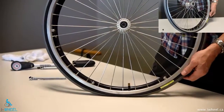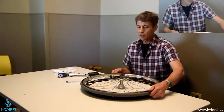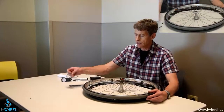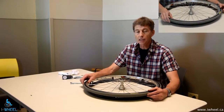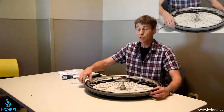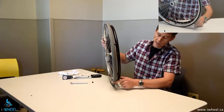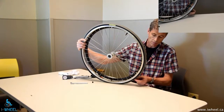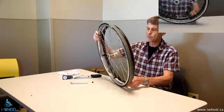However, I'm not going to do that. I'm going to show you how to fix a flat tyre. So let's assume that we've got a puncture — punctures happen typically in two ways. There's either penetration by a sharp object, or if your tyres are too flat and you hit a kerb or an obstacle, you get what's called a snake bite flat, where the tyre compresses against the hard object and you get two puncture wounds from the rim hitting through the tyre.